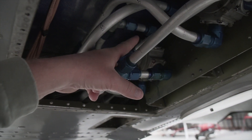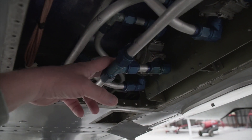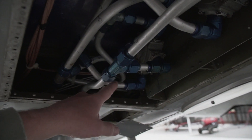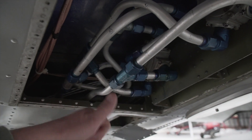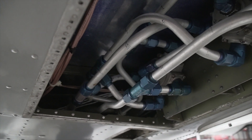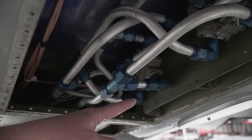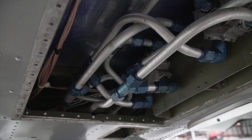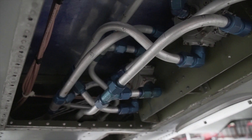So when you open the left front tank, it ends up leaking out of there as it should, but then it leaks past the two rear tanks. I'm assuming it's probably these two bottom ones here that it's leaking past. So it comes into the fuel selector, leaks out these two bottom ones, and ends up filling up the rear aux tanks. Because of gravity, it was trying to equalize — as long as that front valve was open, it was leaking in, trying to equalize with full tanks in the back, and it had to dump that gas somewhere. So it went out the overflow and vent lines and ended up draining a bunch of gas out on the floor.